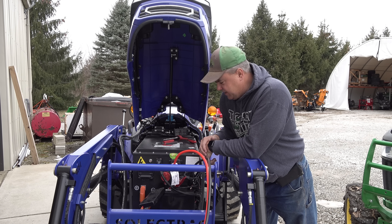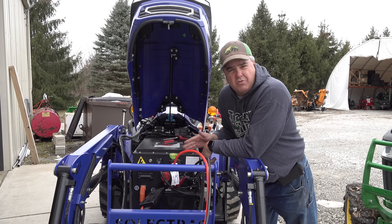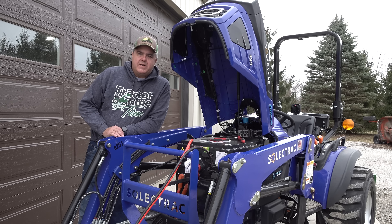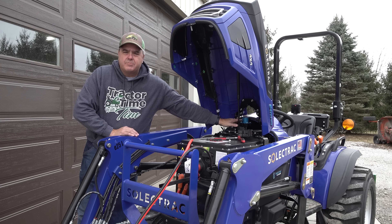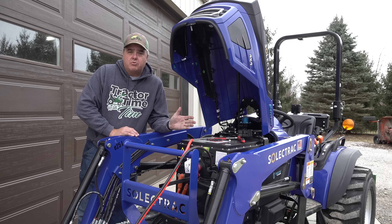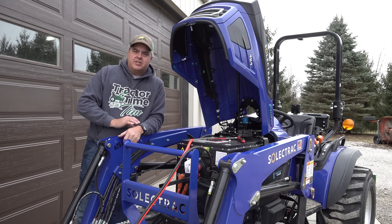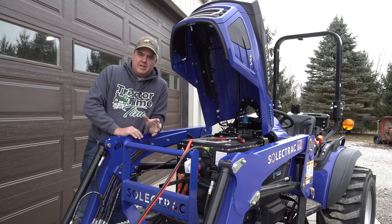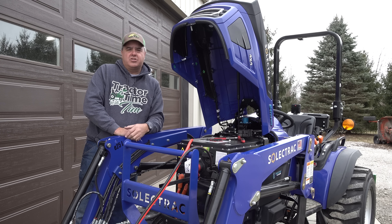I find that a little bit odd — you would think that it would go ahead and charge that battery back up quickly and have it ready to go. But that's not the way it is designed. It will maintain it, so if we don't let it get completely discharged like I did in this case, it should be fine. Probably the most puzzling and maybe frustrating aspect of this is that when I plug in the main charging cable for the large battery, it won't charge at all. The 12-volt battery has to have charge to begin the charging of the main battery. Those electronics have to be able to run before it will even charge the large battery.